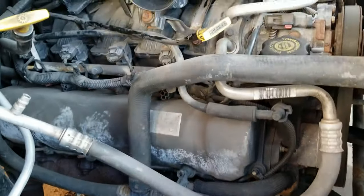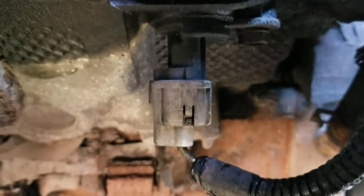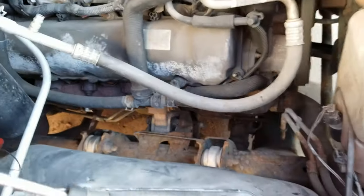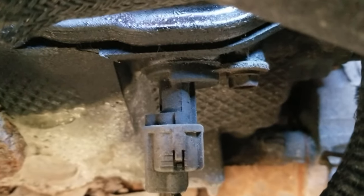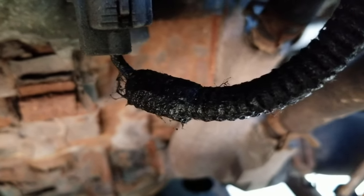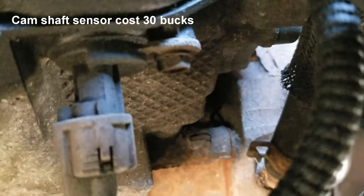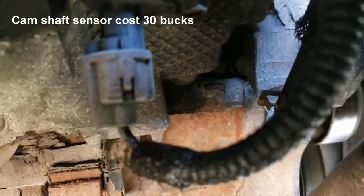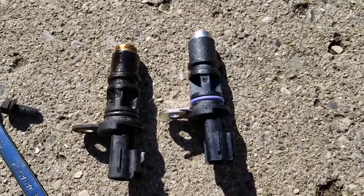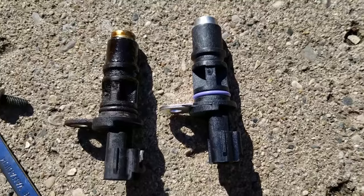If you end up doing the idle air control valve and it doesn't work, I'm going to show you where the camshaft sensor is. It's right there underneath the passenger side valve cover, pretty much at the bottom of the head. It's real easy to get to once you take off the air box — just one bolt and it'll fall right on out. Look at the wire loom there — it's actually pretty oiled up. So hopefully this is what's causing my problem. I'm going to the local auto parts store to get a new camshaft sensor. There's my old camshaft position sensor on the left, new one's on the right. Just one bolt to get it out and it's a 10 millimeter. We're going to throw the new one in and see if this works.